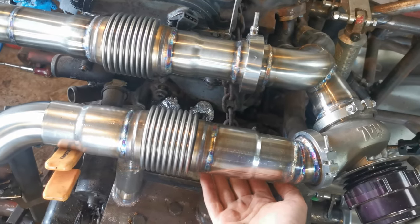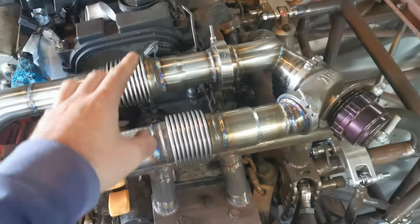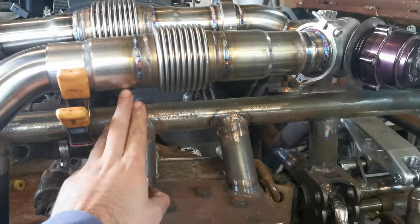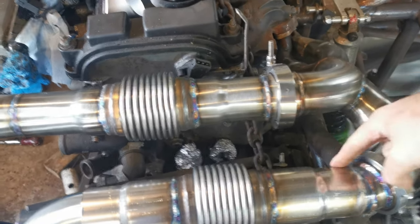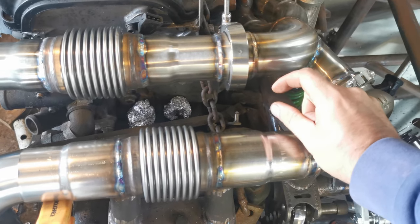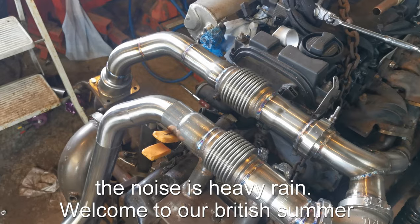What I'm worried about is the weight of this wastegate just leaning on there. I need a bracket to support that weight, but I'm a bit worried about doing it before the flex, because if the engine moves or flexes the chassis a little bit, it'll just snap off. So I think I'll have a support here, and then possibly tie this across here with some sort of bracket — and then like a high-temp silicone rubber with a bolt. Might be a nice idea. Either way, it's coming together and I think it looks quite nice.